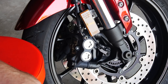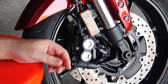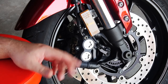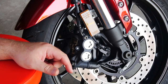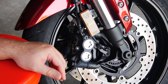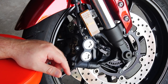Here's what you need to do a brake job on your front wheels. I'm only going to be doing the front in this video simply because I don't need to touch the rear. I'm doing this to upgrade the braking performance, not because it needs a brake job — but anybody that needs to do it because your pads are worn out, this is the simple procedure. I'm not doing the back because the back stock pads are excellent — they already overpower the wheel. This is just for normal street use. If you have track needs, you're probably going to be doing the rear as well — it's basically the same thing, just a little bit different bolt pattern.